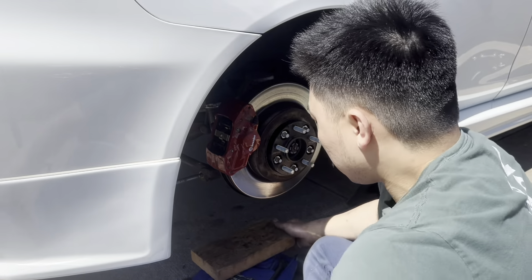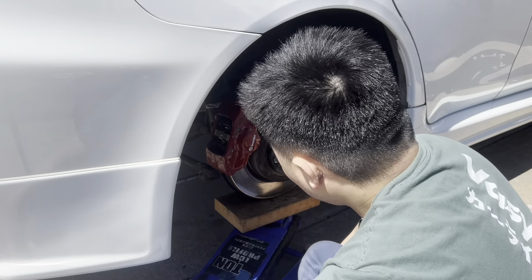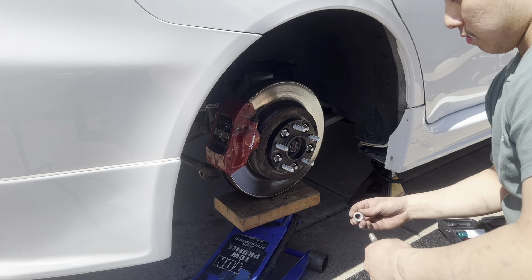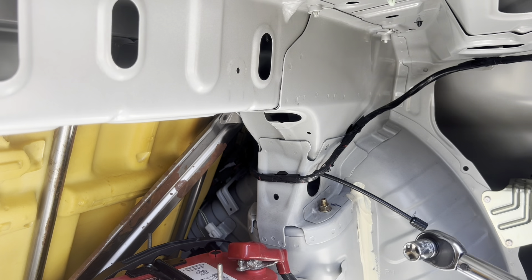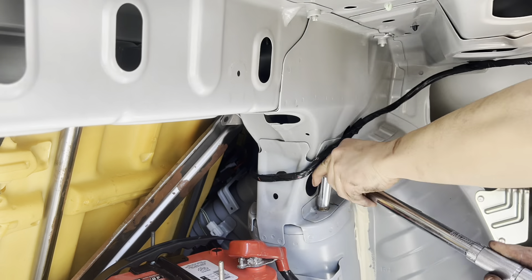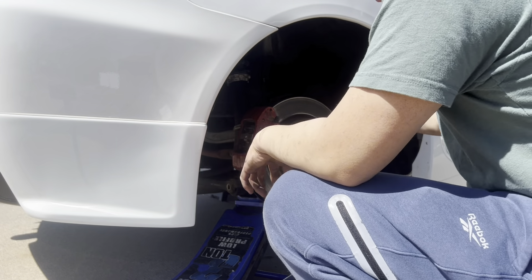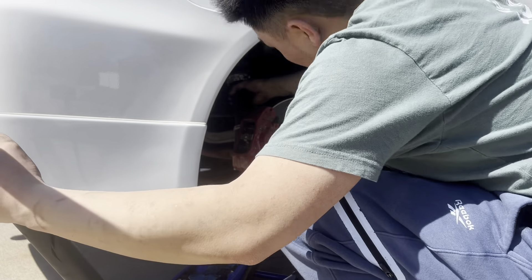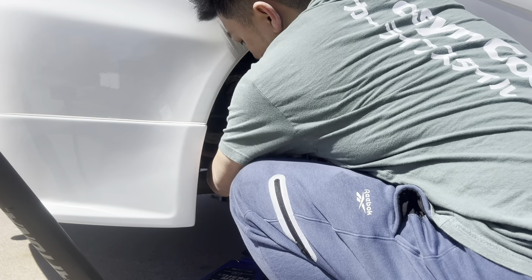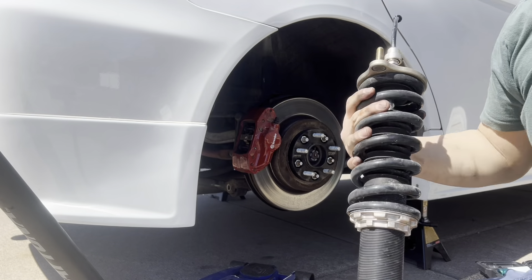Jack this up and then have this part hold the rotor up as well while you're pulling the long bolt out - makes it a lot easier. If you're doing this single-handedly like I am today, it's easier to leave a bolt here loose. Since we got both of the bolts on top out, now all we need to do is release this jack and this should pop right out. There we go - that's the rears off the car.